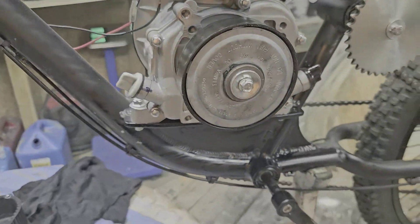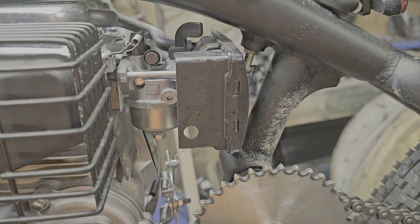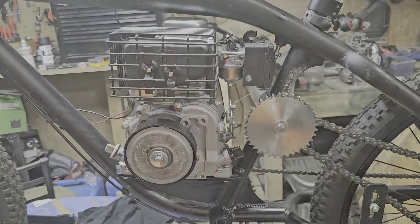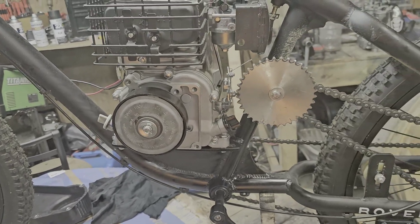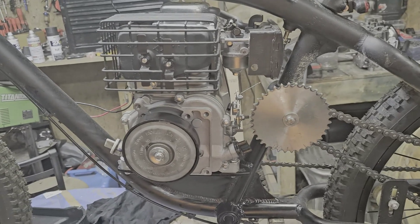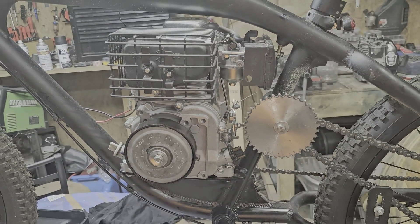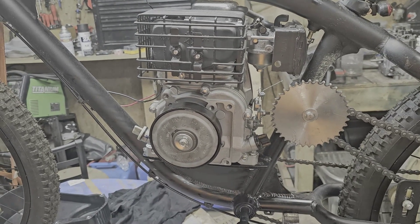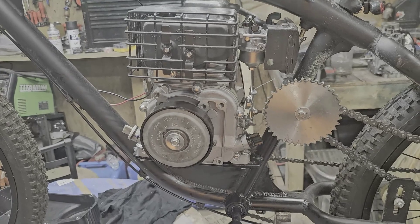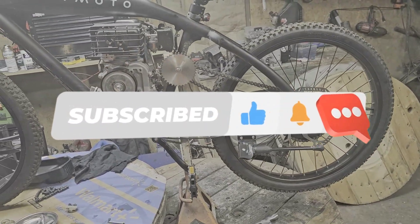It's all back together now. I'm going to hold off on putting the chain on — I've got to order a throttle cable because the throttle cable that hooks onto these carbs is different than the setup that's on this. It'll only take a couple days to get in. The next video we'll have the carburetor done and we'll be taking this thing for a ride. It should gain power just from that setup, but I think I'm going to see a huge difference just from the fact that the timing was off by one tooth. There are some people out there whose bikes are slow and I'm wondering if they're off one tooth — it's not hard to check, and honestly it's almost easier than changing your oil by just popping the side cover. Hope you guys have a good Christmas, thanks for watching, see you next week.